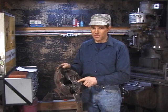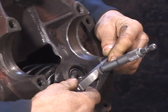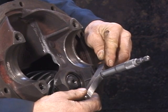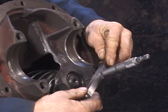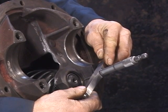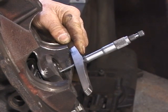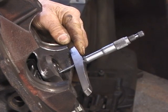Let's take a reading and see where we are. Currently we're reading one inch twenty-seven thousandths, which means our pinion is two thousandths too deep in the housing. We have to increase from a fifteen to a seventeen thousandths pinion shim and recheck our reading. With the seventeen thousandths shim in place, our new reading is one inch twenty-nine thousandths. Now we can install our ring gear, set backlash, and check pattern.